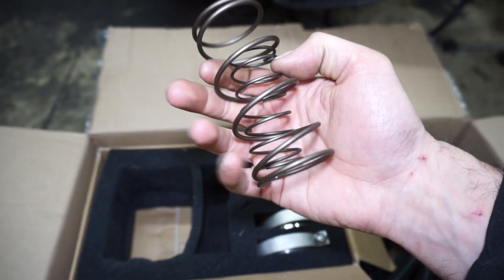I'm marking up the wastegates. I was going to pie cut this section but I'm going to use these leftover bends because I didn't use any bends in the straight section — I had two bends left over. I was looking at my truck and that's kind of where I thought about this idea. I'll use an elbow coming off the bend on both sides. I don't really want to do the pie cuts so I'm going to come off the bottom, turn the wastegate down — it'll be upside down. We'll have good wastegate priority coming right off the manifold into the bend, turning it down. It serves a dual purpose: helps keep wastegate priority and has a smooth bend transition into the wastegate.